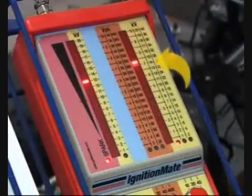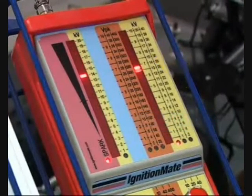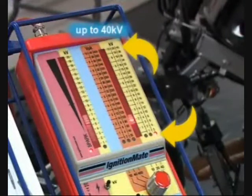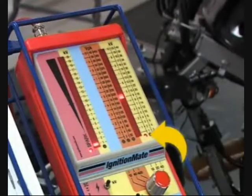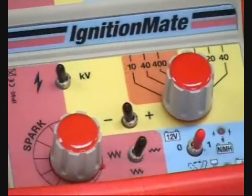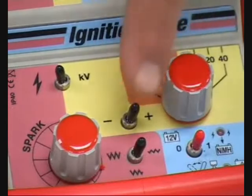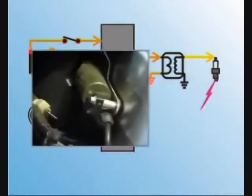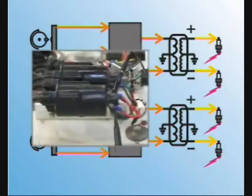The KV scale is used to measure spark plug or ignition coil secondary voltage, check reserve voltage of a coil secondary up to 40 KV, and cranking voltages as low as 3 or 4 KV. The polarity plus/minus switch determines the polarity of the pulses. Single output coils usually deliver negative pulses, while dual output coils have a positive and negative output.